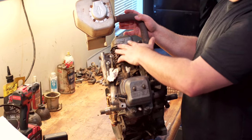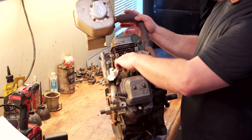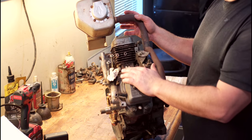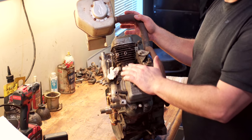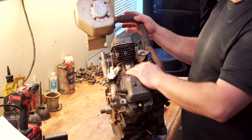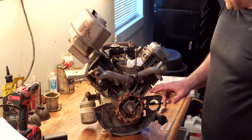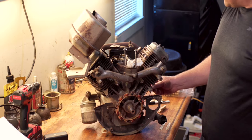There's heavy oil buildup right here. And I believe it's the head gasket in between the block and the jug where the valves go back and forth. It just drips when the engine's running. That looks to be the only spot where the oil looks to be heavy. So we are going to be replacing this head gasket along with the other side, intake and exhaust seals. The sump seal's already been replaced. Did replace the stator on this unit. This is the stator off the 18 horsepower, single wire instead of the double.